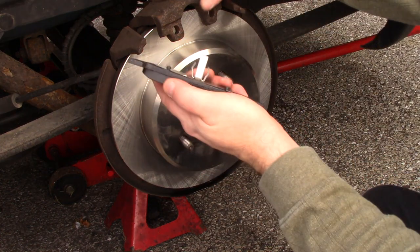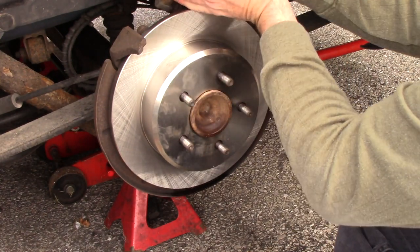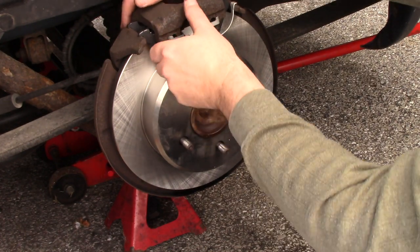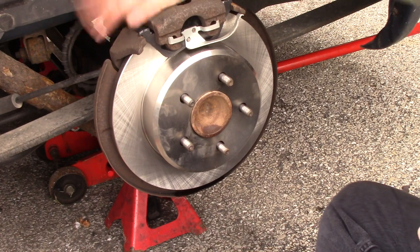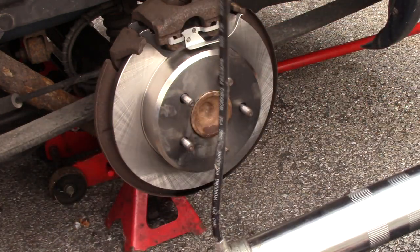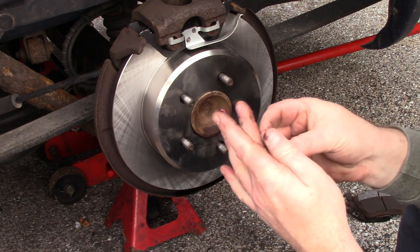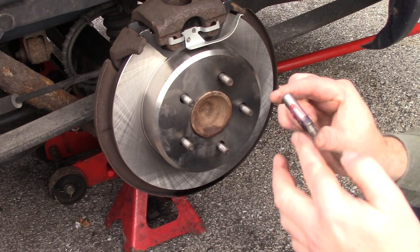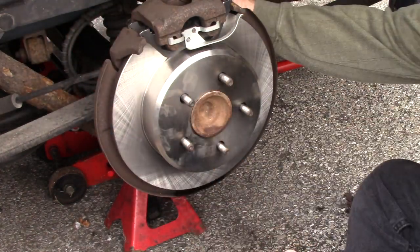We're going to first put the inboard pad and it just clicks in like that. The second pad is a weirdo because it kind of has to be shoved in — just give it a tap. Make sure your pad alignment is correct. Trying not to scratch the brand new rotor — and there, that holds it down. Now I'm going to take a little bit of grease. I just use the chassis grease gun. This is just some red high-temperature grease for chassis lubrication. I run some around the shaft because this is what floats when you hit your brakes and you want these to be nice and goopy. Reinsert and repeat for the other side.